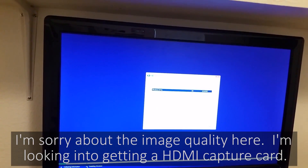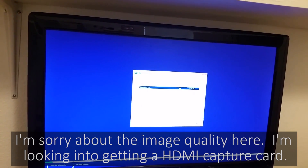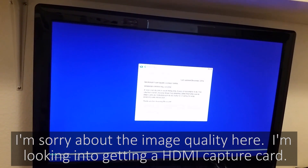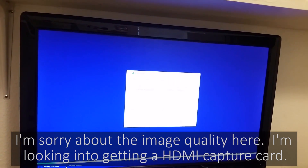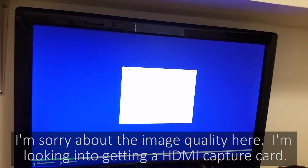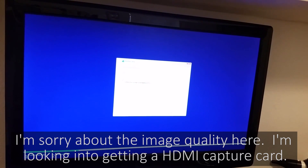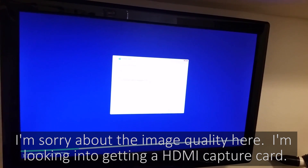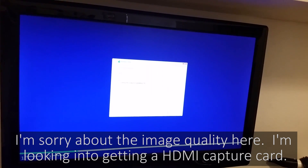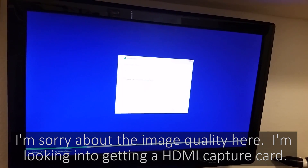Let's get Windows 10 installed — I have it on a flash drive. I'll skip entering a product key for now and enter the Pro key later. Make sure you choose the version you're actually going to activate, otherwise you'll have to reinstall Windows. Do a custom install — it sees the drive, hit Next and it will partition, format, and start the install. When installing Windows onto an M.2 SSD, Windows 8.1 or 10 will usually just see the drive. Windows 7 on M.2 can get complicated. I think I'll end the video there — thanks for watching.